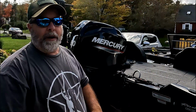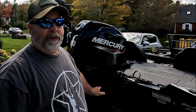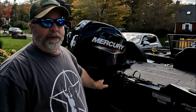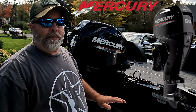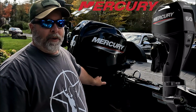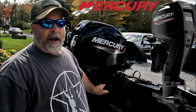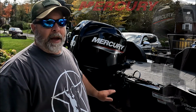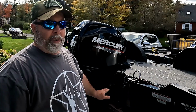Okay folks, today we are going to do a very simple but very necessary job, and that is changing the fuel filter in your Mercury outboard. Now this applies to 40, 50, and 60 horsepower EFI Mercury engines, and it should be done every 100 hours of usage or annually. I generally do mine once a year, and when I change the oil, I do it while I'm under the hood. It's a super simple task. I'm going to walk you through it.